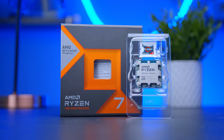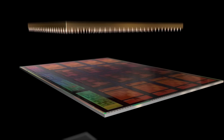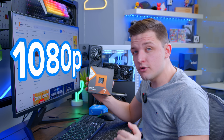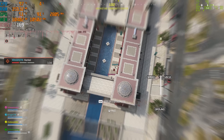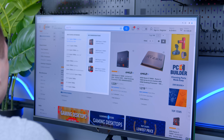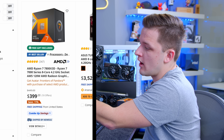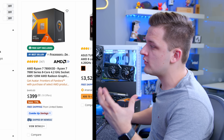If you want to step up performance with a couple more cores and get slightly higher frame rates, the Ryzen 7 7800X 3D is going to be your best bet. It has AMD's 3D vCache technology, which gives you loads more L3 cache and unlocks one of the biggest bottlenecks. It's particularly useful for 1080p gaming, where at lower resolution the CPU becomes more of a bottleneck than the graphics card. The 7800X 3D is currently sitting at $399 on Newegg, though I've seen it go as low as $350, pushing us closer to that $1,000 price bracket.